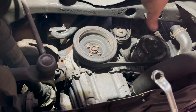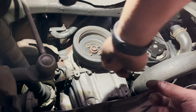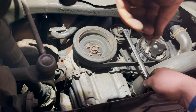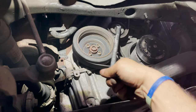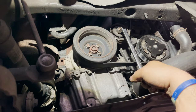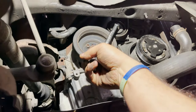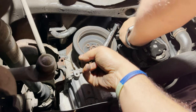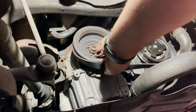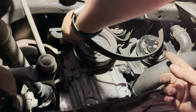All right, really nice how Volkswagen did this panel here. Very easy to remove. It gives you great access to the pulley here. So 16 mil, I believe. And I've got a little pin just to insert in the right place if I can see it. I probably need the light a little bit closer. Oh yeah, there. Just a drill bit. Now I can remove the drive belt. I can see some signs of wear there on the compressor.